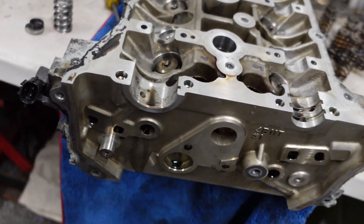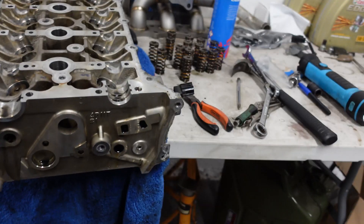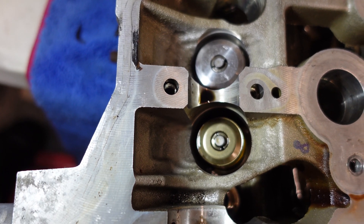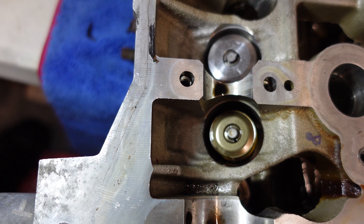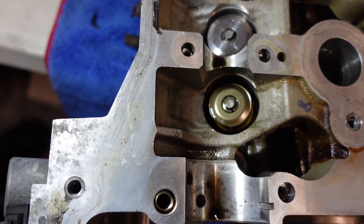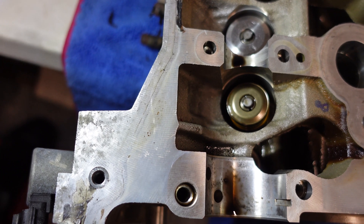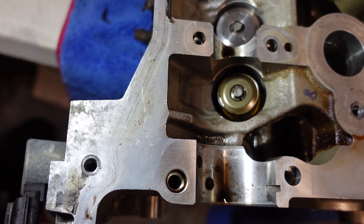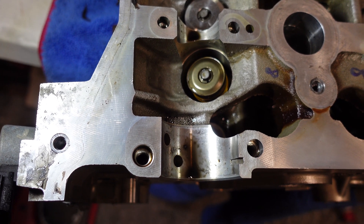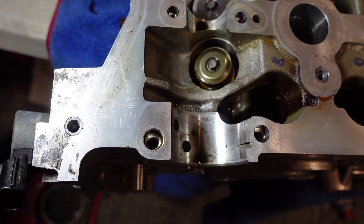The first thing you're going to need is a decent valve spring compressor tool - this is really worth its weight in gold if you're trying to do this job. As you can see there are semi-circles in the top: the circle on the inside is actually the top of the valve, the two semi-circles are the valve retainer wedges, and the outer circle is the spring retainer which stops the spring falling out. The spring presses against that outer circle and that's how the valve comes back in once the camshaft has pushed it out.